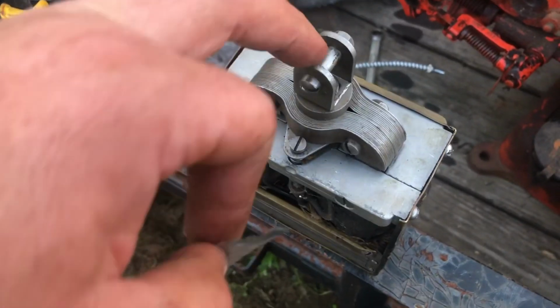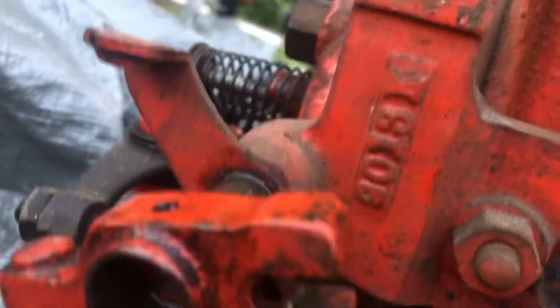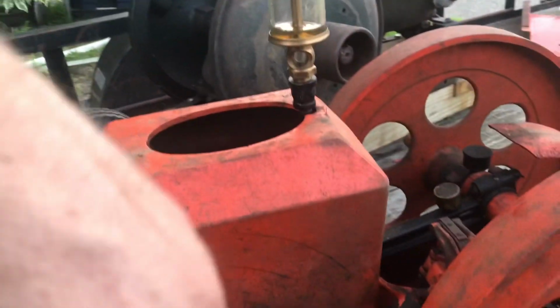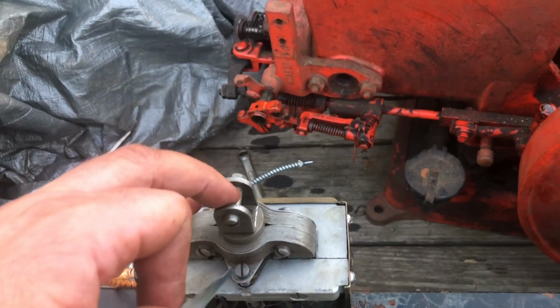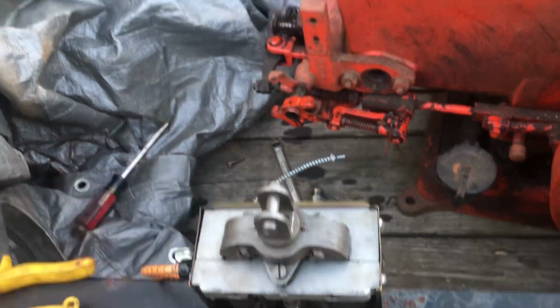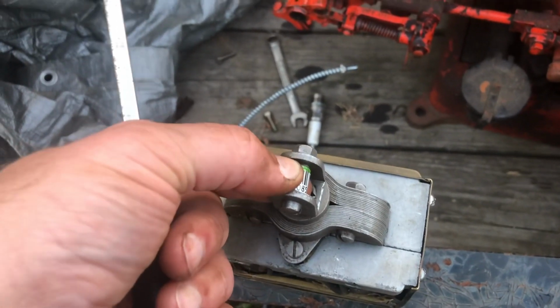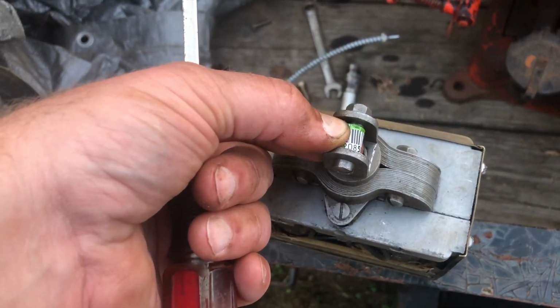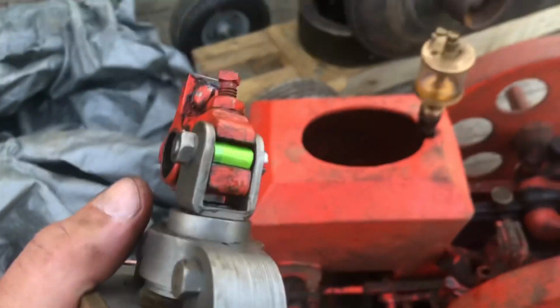Well, just touching this pin with my finger, it's hard to see, but under my finger here is a complete flat spot. And it's all worn. And looking in here, there's not a spot that should be flat and a spot that shouldn't be flat. So I have a feeling that the guys that warned me that my pin was worn may be spot on. Either that or I need to rotate the pin, turn it a little bit so that the flat spots line up differently. I'm not sure, but I'm going to wrap it. All right, so I got about 3 turns around it with the Mountain Dew can. Let me see if I can actually get it into the holder there and see if that helps us out. I suppose I could buy a little bushing to put over it or something, or I could just look for a new pin. All right, so I got it squeezed in there.